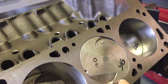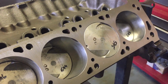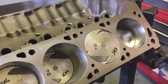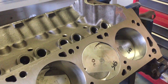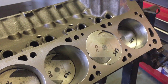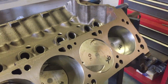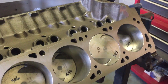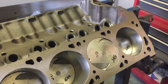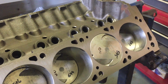You know, they probably didn't want to come above the deck, and I'm not sure exactly, but that's the approximate measurement. Ford just decided to take a 32nd of an inch off, which is approximately 32 thou, or about 30 thou. And that will bring the piston up to the top. And once you bring the piston up to the top, that means that there's more compression, there's a smaller area for the combustion process to take place. And so the Phase 3 engine went from a standard 4V compression, which was probably around 10 to 1, up to closer to 10.75 to 1, or what they thought was close enough to 11 to 1 compression.